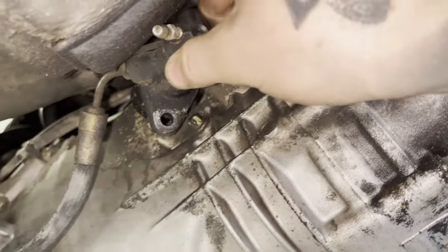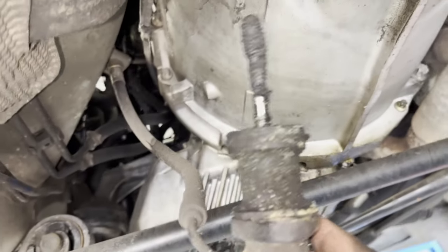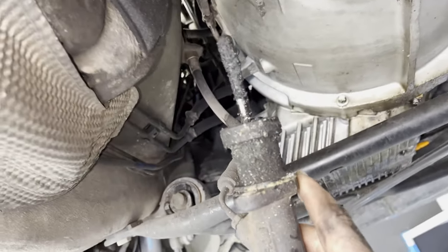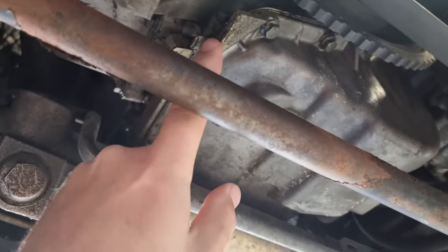So yeah, slave cylinder, obviously you've got your pin here that pushes up against your clutch fork, quite wet, leaking fluid, and it seems to be our problem. Let's get one of those underway and get it replaced. Got a bit of a leak at the front main, I think.